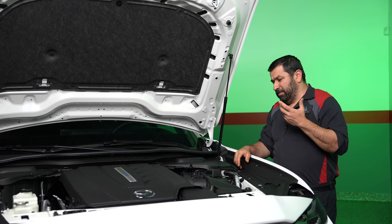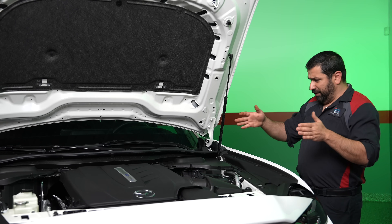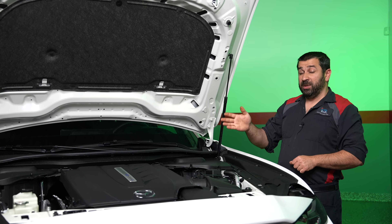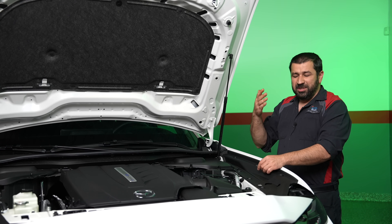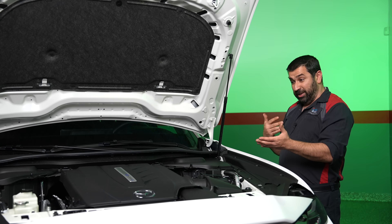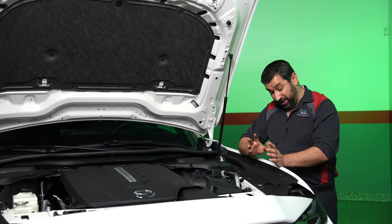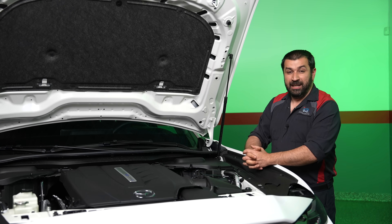The real problem happens when you go into hybrid mode and switch back and forth. You're driving in hybrid mode, the engine is off, you're in EV mode — then you accelerate. Everything stops: the clutch disengages from the transmission, the clutch between the engine and the motor engages to start the engine, then the other clutch engages and we're going. There is a noticeable delay and clunkiness. Coming to a stop, it wants to shift to EV mode and shut the engine off — you feel every single transition and they're slow. On the CX-90 Mazda did issue a software update to smooth things out, and it feels like this particular one didn't get that update.